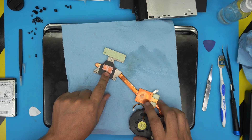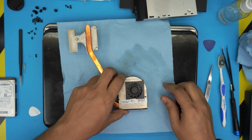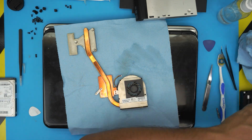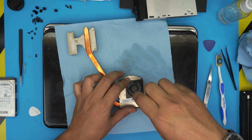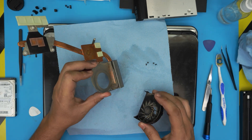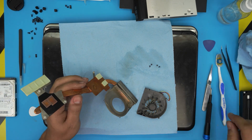Now there's also some oxidization and discoloration on the heat sink that we need to clean out. First, let's service the fan: remove the four tiny screws — Phillips double zero, though Phillips one also works fine. Once removed, pick up the fan and bring it up. You can see why it overheats and throttles — look at all that dust clogging it.